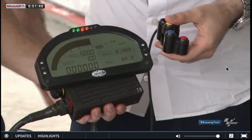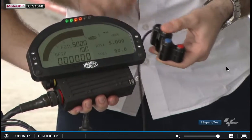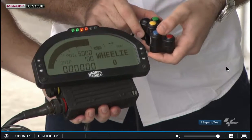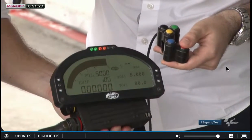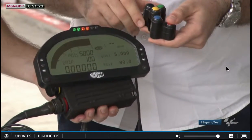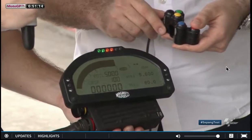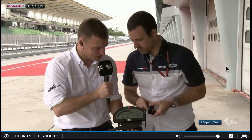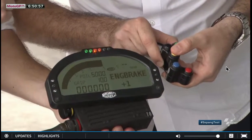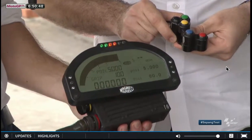So now I'm going to pretend to be your rider and we're going to do a little lap of Sepang with this screen. I'm coming down the main straight and I'm actually finding my bike's a little bit slow — the anti-wheelie I feel is coming in too much. Can you change that for me? You are at 300 kilometers per hour. It's in here — so plus one for you is less anti-wheelie. Riders are so focused that sometimes they forget about it. We did it already. So you've now given me less anti-wheelie — it's less intrusive and I can get on the gas a little bit more. That's right. So now I'm going to come into turn number one and I find I'm not getting an awful lot of engine braking. Out of turn number three, the bike's upright a bit and I can have another play with my switchboard. Let's go to engine brake strategy and change the level. Fantastic — so now I have more engine braking for when I go into turn number five.